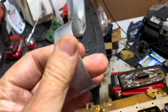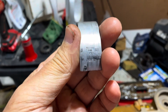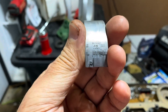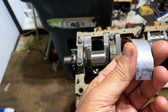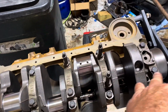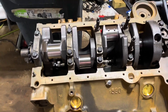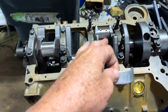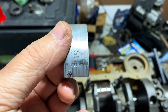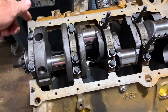Being a shop with multiple engines going on, I buy V8 bearing kits for my V6s. I do that for two reasons: the V8 kit is cheaper, and I get one extra bearing pair because a V8 has five main bearings and a V6 has four — so one bearing pair is left over. In this V8 build I happened to have a spare 0.010 bearing, and I put it in number two — problem solved.